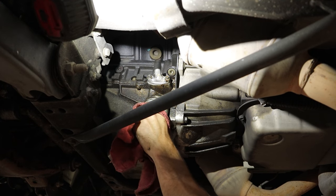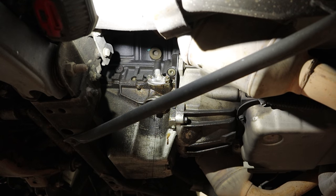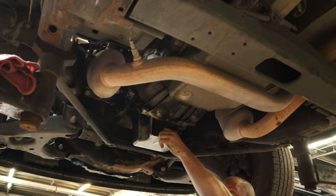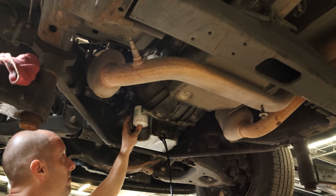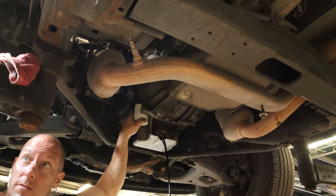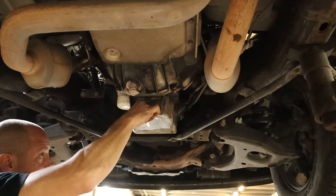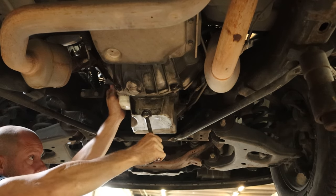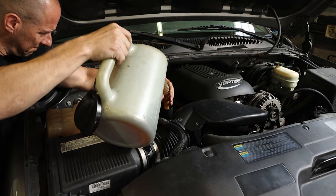While we're here we'll spin the oil filter off and give it an oil change. Put the oil plug out — came out without a breaker bar; guess it wasn't done at Jiffy Lube last time. Conveniently hang our drain plug on the exhaust. Screw our drain plug in there and we'll go at it with the one-inch impact. Throw our oil back in — most of it; some of it will just get all over the manifold and give that nice smoky smell.